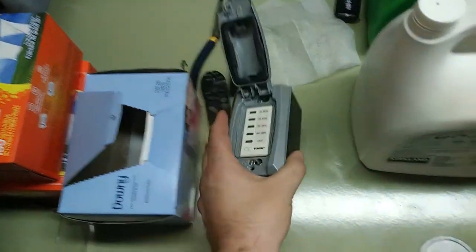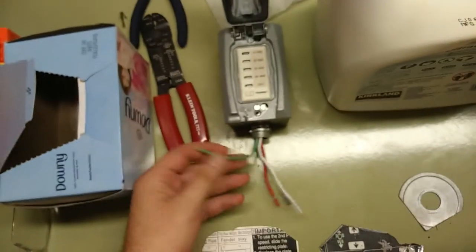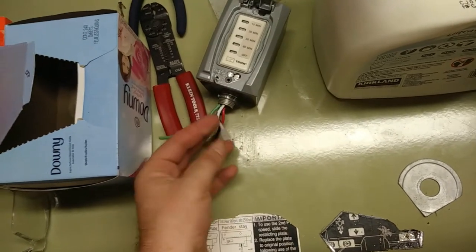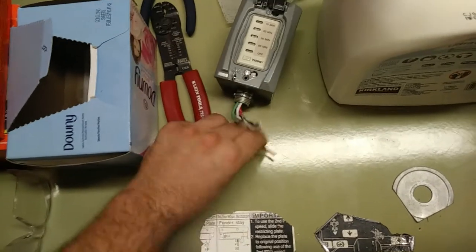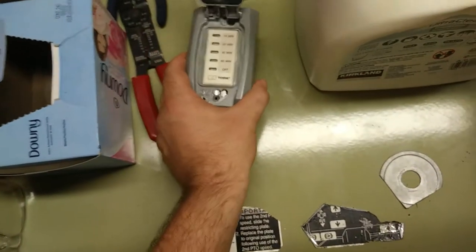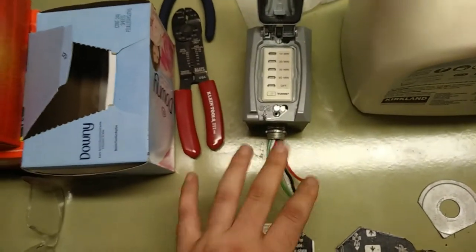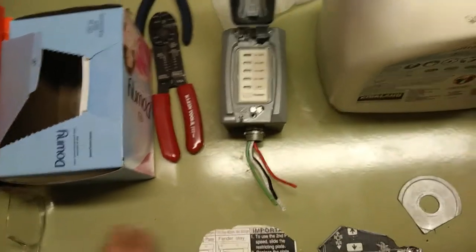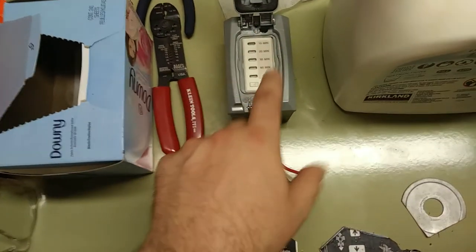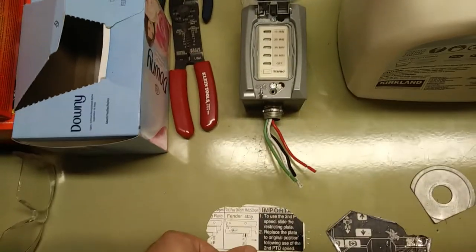I just poked all the wires out here. No need to make any connections inside the box. It can all just happen out here. Ground connection, neutral to power the timer, and then this is the incoming 120 volts, and this will be the outgoing to, in this case, the coil of the contactor. Obviously can't run everything through this. This is only 15 amp rated or so, and it may pull only around that once it gets up and operating, but the peaks are higher than that for sure when it kicks on. You might get away with it, but it would probably burn out that timer pretty readily. So yeah, this is what I'm doing for now.